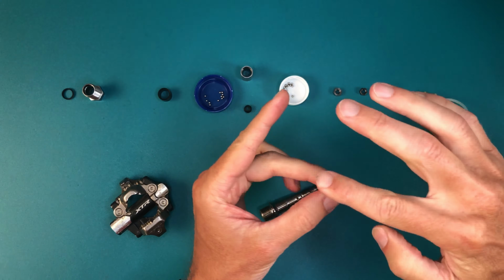One end of the silver bush race is chamfered a bit, so you can tell which end goes up. If you get the inner bearings set right, then the outer ones are a bit easier. That little black plastic slide-on piece helps make sure you don't drop one down the axle and mix up the sets. Extra grease helps hold them in place while you're getting it all set.